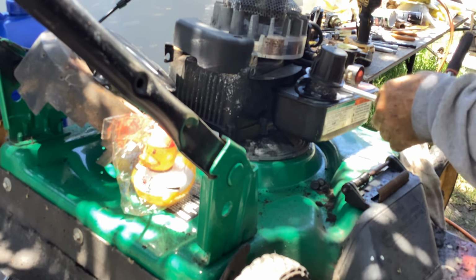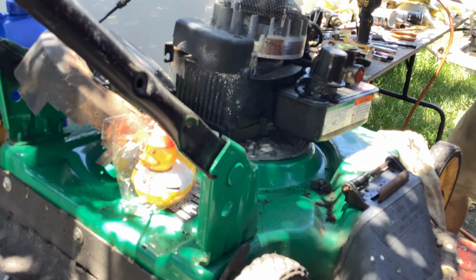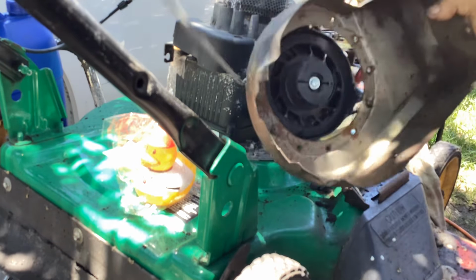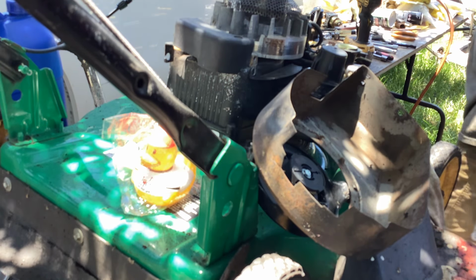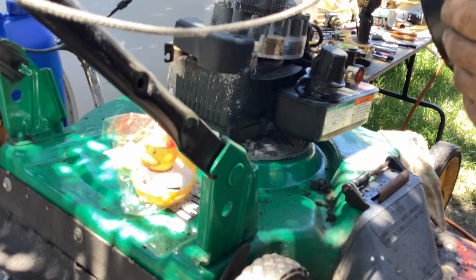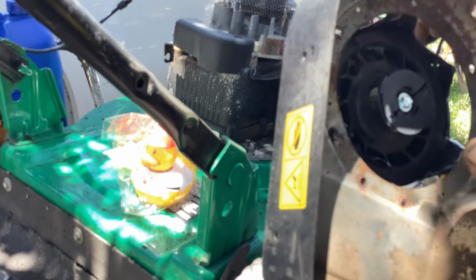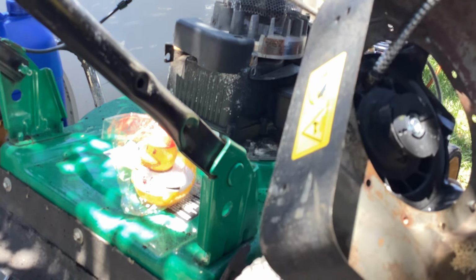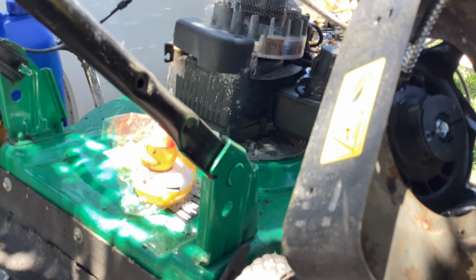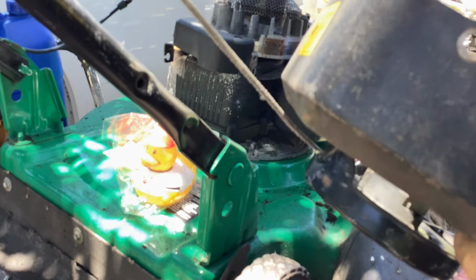Okay. That's good. I'm going to grab my oil can. Just put some oil on this. I look for the spring where it makes the 90, and I just squirt a couple of squirts in there. Let the oil go down and coat the recoil spring. And a little bit on the white pawls.